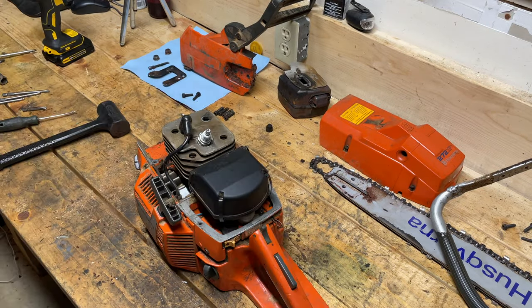I have a little bit of sandpaper and I'll start going at it with a thicker grit, then back it down to something smoother for the finishing touches. I figure it's worth a try to clean this up before spending $100 on a piston. I'll show you the ring too — the ring isn't terrible, you can see the scuff marks. If I can get 150 PSI out of this thing without having to put a new piston and cylinder in it, I'm laughing. This is 300 grit sandpaper — it's pretty coarse for sanding down aluminum, leaving some relatively good-sized scratches, but I plan on using 1000 then 2000 to clean it up at the very end.